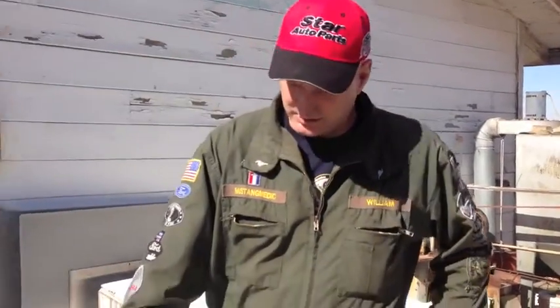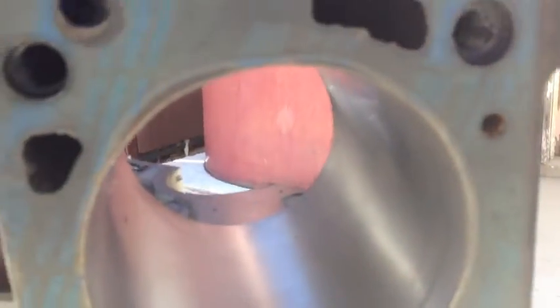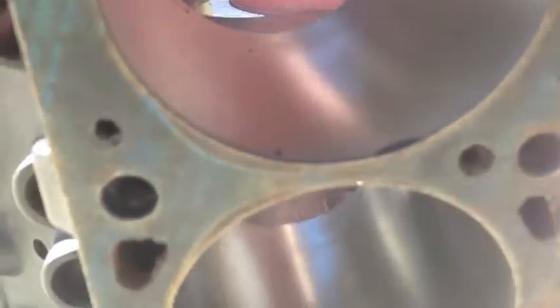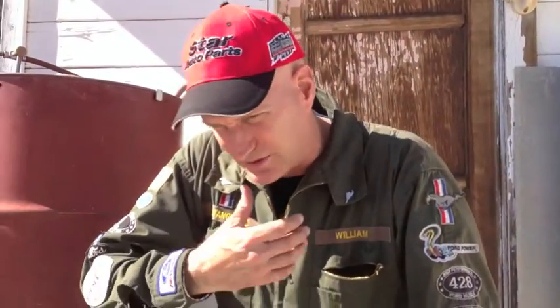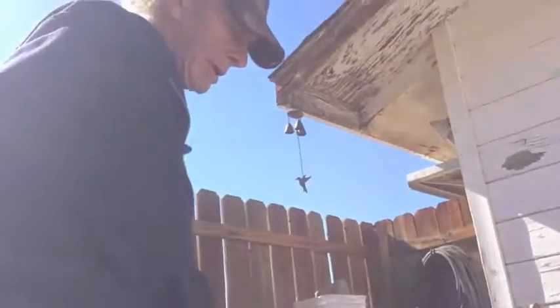Get a close look at these cylinder walls. It sounds like a basketball player with sneakers. So that's a 60 over cylinder wall. This engine's been rebuilt numerous times, which means it can't be rebuilt again. If we put the pistons back in where it was, are the cylinder walls good? We don't have to buy pistons — use the same old pistons. So we can put it back together again. We just need to hone it. It's all honed. Oh — I thought we had to get a new block. We can use this block. That's good news.